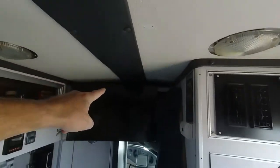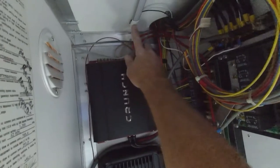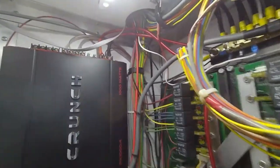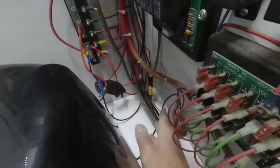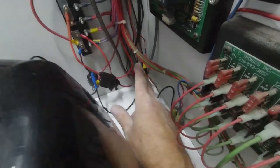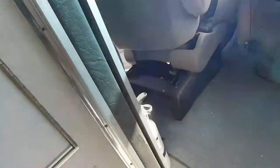I was able to cover it with this pad and it runs all the way up front, then drops down along with the wires for the roof vent fan, and then it comes inside the electrical cabinet here. It drops in and runs down, and I've just joined it into another cable coming from up front right here, soldered in this trigger line here which turns the camera on.